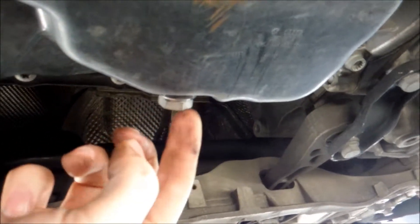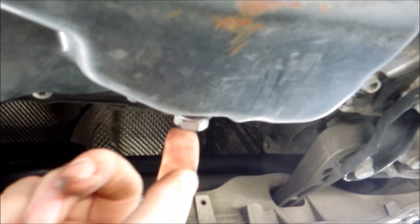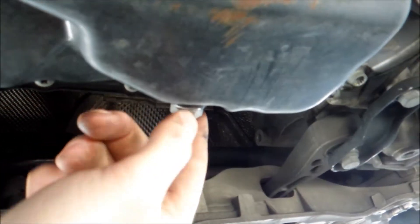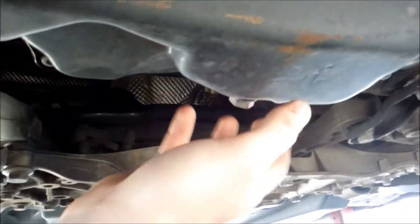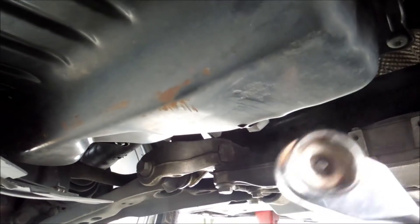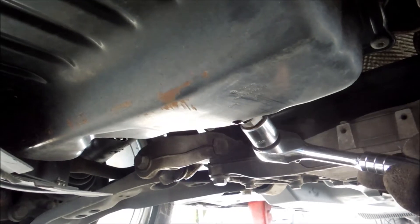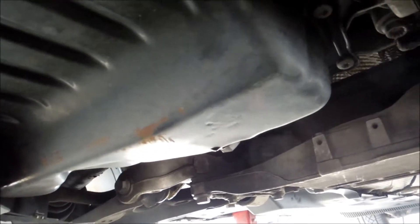See that bolt? Let's go from the front — I'm under the grille. Right from under the front you'll see the engine, and right here is your drain bolt. We just have to loosen this one off. It's a 19mm socket. Get your drain pan ready and let's drain some fluid. Remember: righty-tighty, lefty-loosey. Just loosen it up.